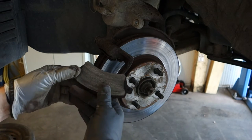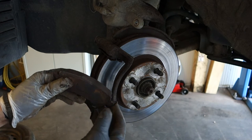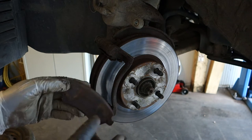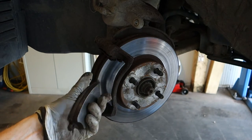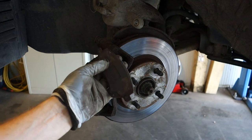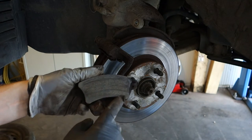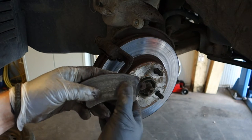Because I have had this issue that my brakes make small noise, it means I have to take all of these pads away, and then insert lubrication here. Here I can see that there is no lubrication, and that this is an aftermarket brake pad, which is a bad thing. I always recommend, to you and to myself, using Toyota brake pads, because they last maybe 10 times longer than aftermarket parts. Normally that material is really hard, and brake pad material must be soft.